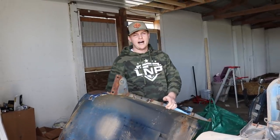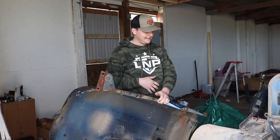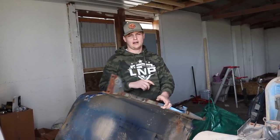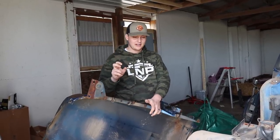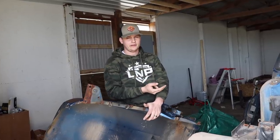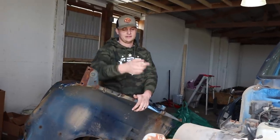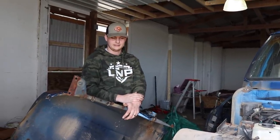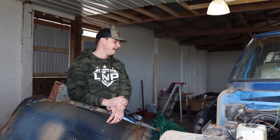Okay, but here's the thing though. I took the absolute most difficult way to get this thing off, and you know who you are, but I think there was one guy that commented under the video of me saying I'm tearing apart my first gen. He's like, you do know that there's two bolts under the fender, and then that whole core support comes loose, and then you just have to pop off the others above the headlight, and then you're done. I'm like, you're kidding. He's like, no, and then you don't have to do your cutting and crap. So I was like, oh, great, nice.